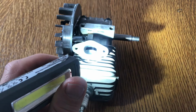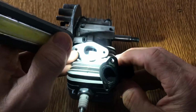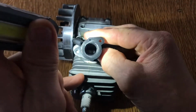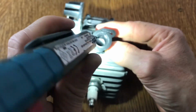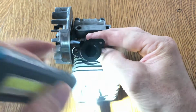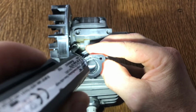So if you actually look in there, that's a circle. First thing is obvious, that's a circle. That's all nicely chamfered down to that edge. But when you look at that, the first thing that is glaringly obvious is that the inlet is not a circle, is it? So when you put that onto that, just loosely like that, if you look down there, can you see it's going to hit? There's a huge restriction. Top of it's a bit harder to see, oh, that's better, you can see there. You see? That's just hitting that wall there. Hang on, let me get that on accurately. Look there, you see it's hitting there, it's doing the same at the top there. So you've got a circle going into basically an oval, and that's going to trip there, so you're going to get loads of turbulent flow through there.